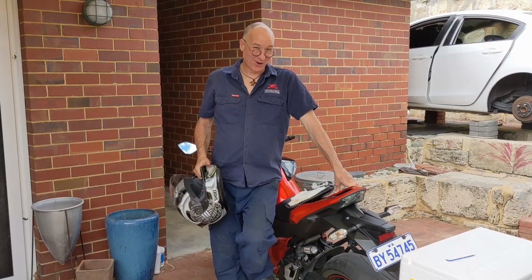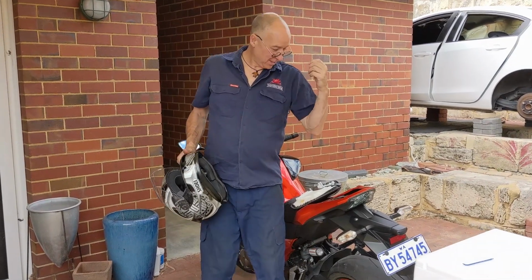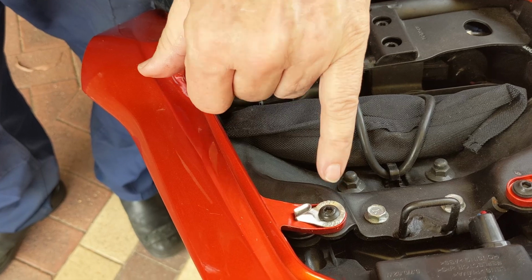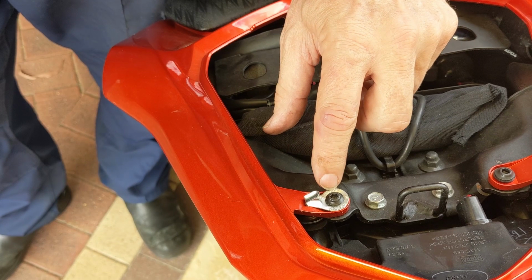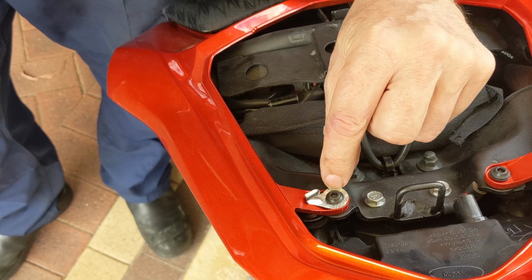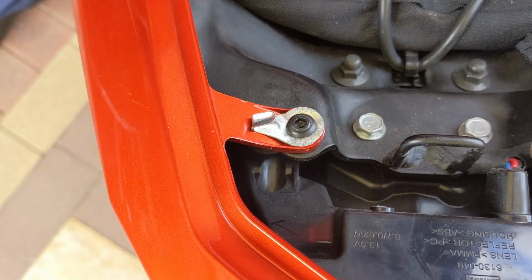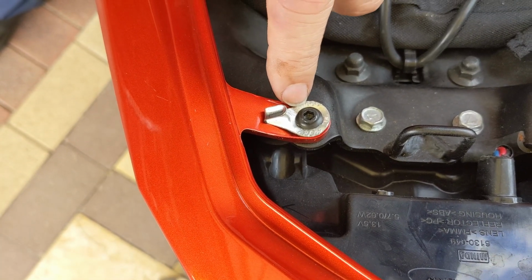Okay, so that just shows you I didn't rehearse anything. I really was doing it for the first time, but I've had success. Effectively the problem I had there is that these picture hooks are made of a very, very mild metal, but that ended up being both a plus and a minus. Once I got it straightened out and got my 5.5mm hole in it, the fact that it was malleable meant, you can probably see there, I've actually concaved it to get it to fit into that spot. I have actually bent the metal, so the fact that it was mild actually ended up working in my favor.